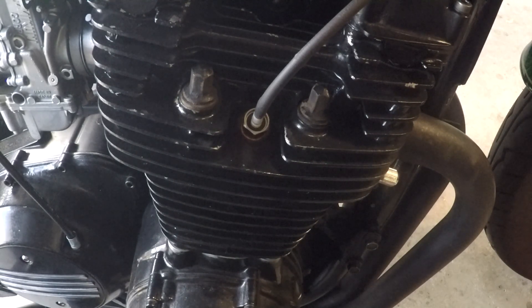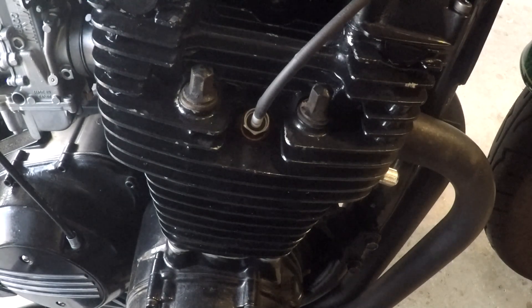There you go — the pilot circuits were quite rich on this bike. Actually, this one on this side wasn't too bad; one, two and three were worse. Milton did lean them off a bit for me during the initial tune, but this engine's been rebuilt since. I'll probably need to get these carbs rebalanced again and then have another look at it. But look, it's nice and easy to use and actually pretty quick — you can see instantly. You don't have to try and hear for a change in engine note, which isn't always easy across multiple cylinders, especially for someone with not the best hearing in the world like myself.